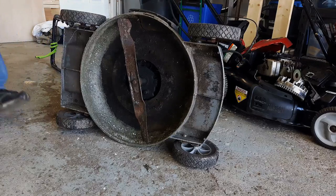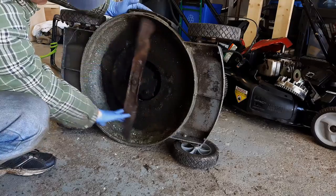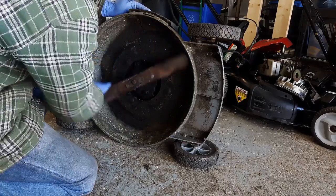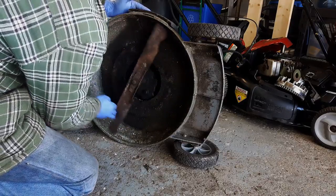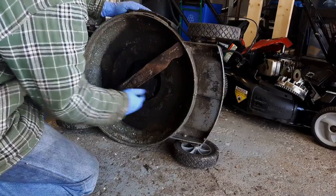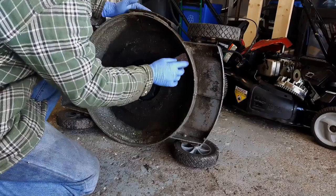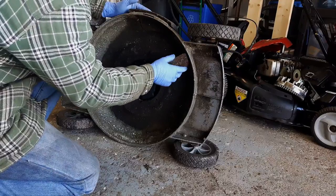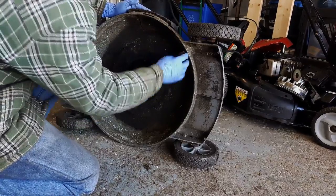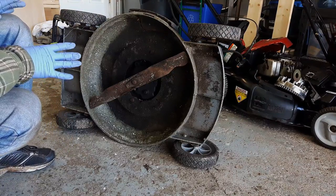I'm going to clamp the brake cable — it's a little easier for me to spin over. I'm kind of looking at the center bolt and it looks pretty straight. I don't see any bend to it at all. You can tell at the base of the crankshaft, and the other way is to check the distance. That could be a worn down blade as well, but everything looks good there, so I think we're going to go ahead and try and revive this.